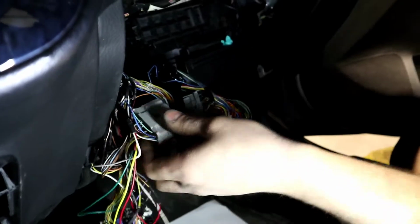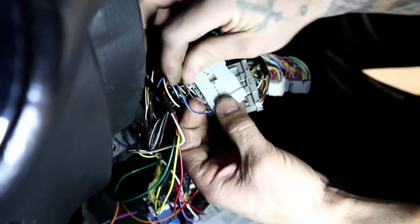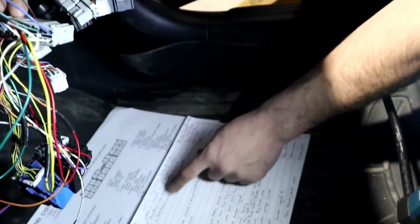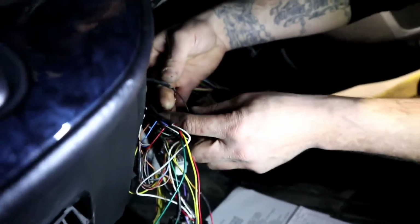Now connecting to the body harness side, it changes. It's no longer red-black. It's actually the opposite. It's a black with a red stripe. So let's go to the ECU side. Number 2. Oh, there it is. Black with a red stripe. That's why I'm saying it's crucial to pay attention to the colors of the wiring. So number 2, on the body side, it says that it's connected to the ECU D plug number 4, which was the wire we already previously spliced. So simple.